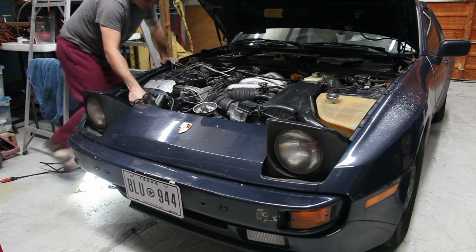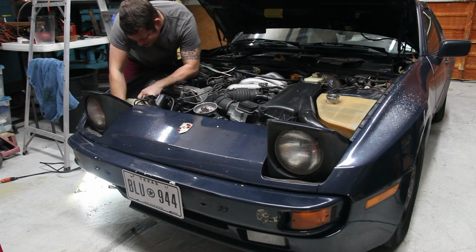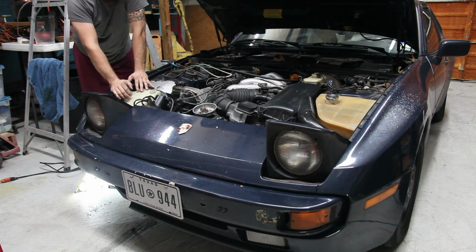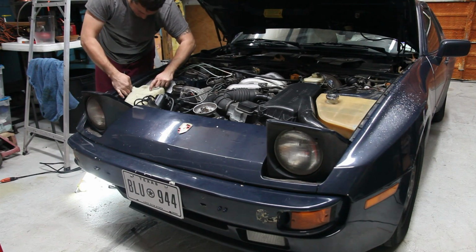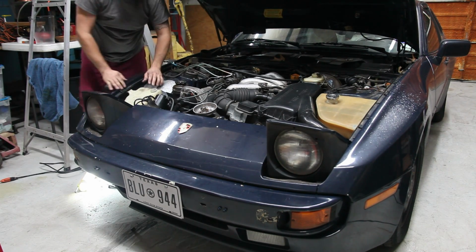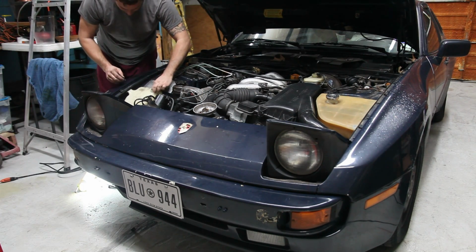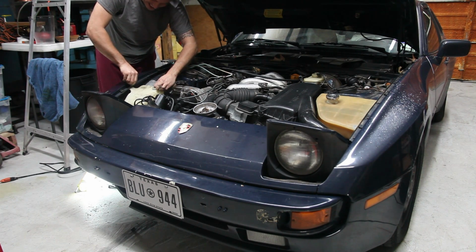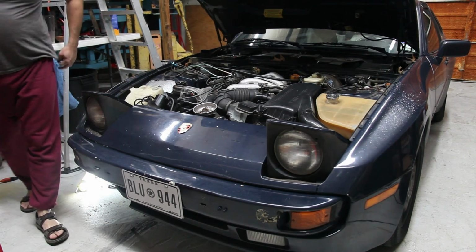We're most of the way at this point. What happens is the power steering cooling loop is a bit of an interference fit, so if you just pull gently and firmly it will come through, at which point you can reverse the process and begin to secure things up. So I'm going to put the first bolt or screw in, and I'm just going to hand tighten it. That'll make it easier for me to work on the bottom part of this where it's more of a jigsaw puzzle.